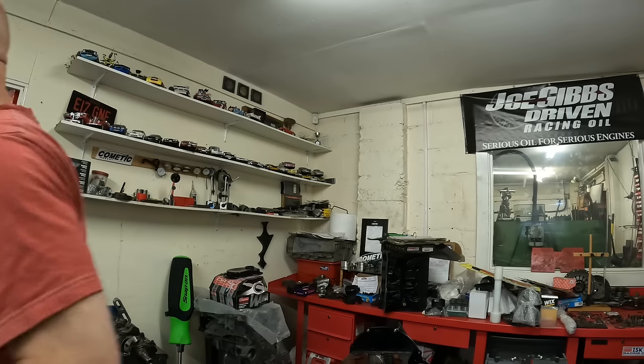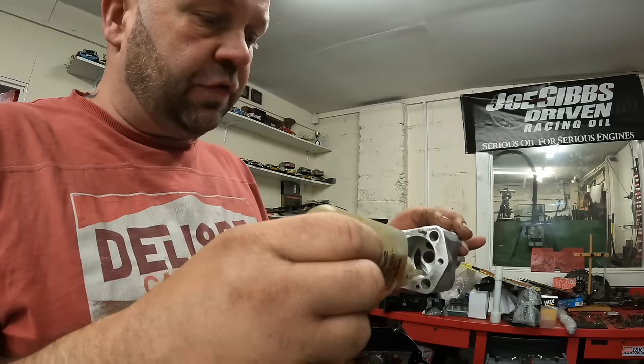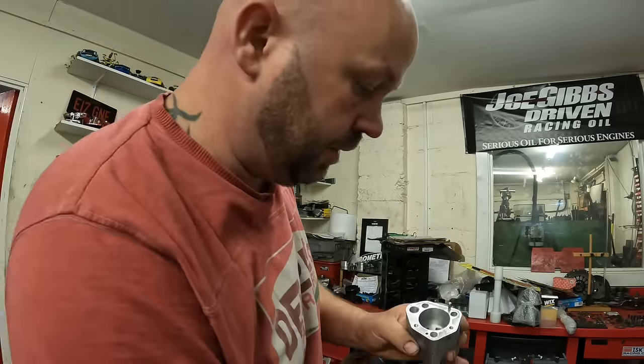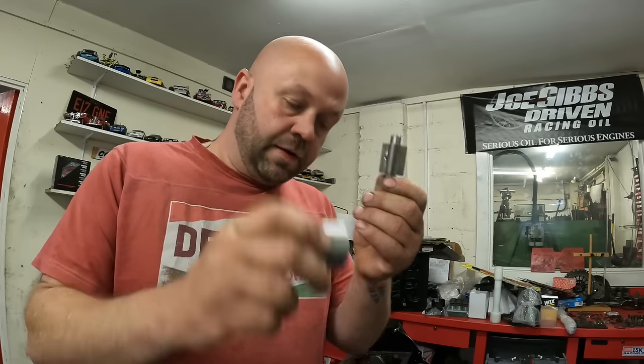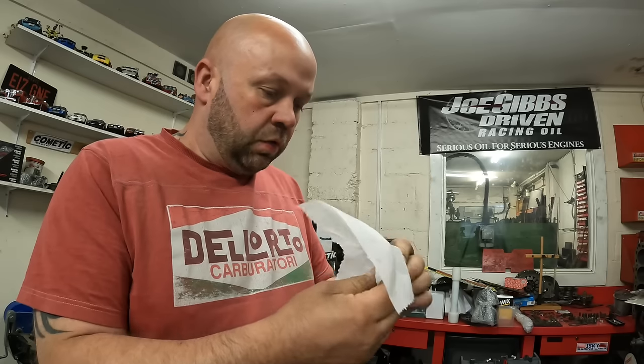And then the next thing is to lubricate the body of the pump. So what I'm going to use for that is just a bit of 20/50 running-in oil, all the way around the body of the pump, and then down in the bottom, ready for the first rotor to go into. Then with some nice clean rag, just make sure the two rotors of the pump haven't got any rust protection on them. I mean, I have gone over these once, so I do know that they're clean, but this is the procedure that I do on all of the engine builds. I always take the pumps apart and double check them.